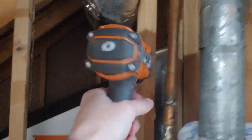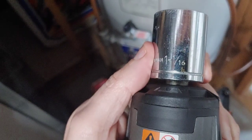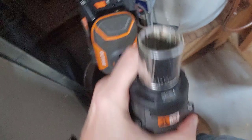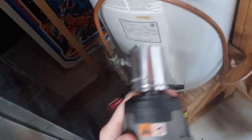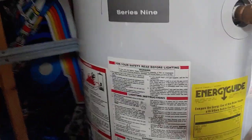It's put in there pretty tough — you can get it out with a breaker bar, but in this case I have an electric ratchet gun and mine takes a one-and-one-sixteenth inch socket. I know that's not an impact socket; I just have these lifetime Stanley sockets, so if one of them cracks I can just get it replaced under warranty.